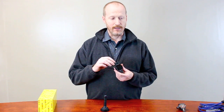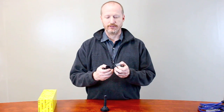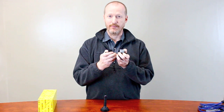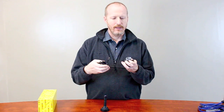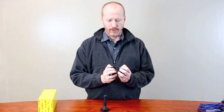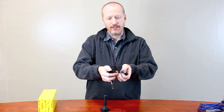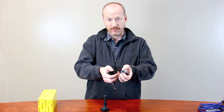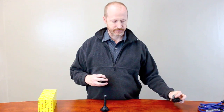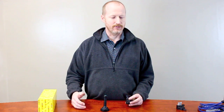The thing you have to remember is that there are a couple of different designs of these coils. We have seen cars come in that had the wrong coils on them. In theory, in a perfect world, there are two different colors of electrical connectors — a gray one and a black one — and you should color code them. I don't think we can depend on the manufacturer staying with that in the long run. So you either need part numbers or look at the pattern of the pins inside the plugs and sockets to make sure they're the right ones for your car. I've seen a lot of cars that had the wrong coils on them and they still ran, but it certainly gives you some liability and reliability issues in the long run.